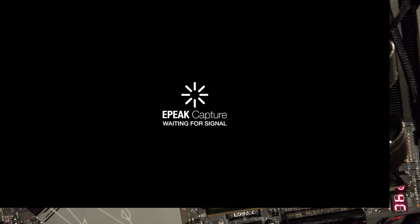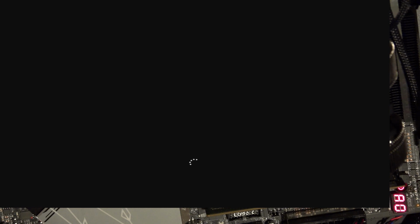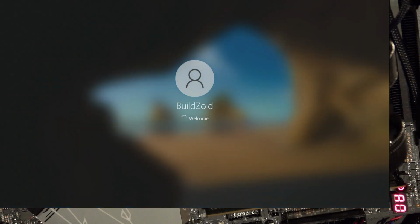So, that's something to keep in mind if you're working on Gigabyte motherboards, I guess. Actually, probably on all motherboards. If you're doing memory overclocking, you should probably disable fast boot, because basically all it does is skip the memory training. So if you change timings, it'll actually just not change them, because the memory controller won't go through the procedure of actually applying the new memory settings. It'll just use the old settings.